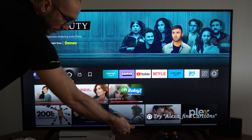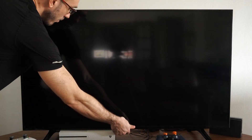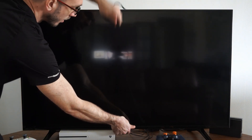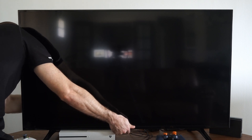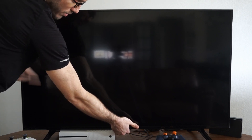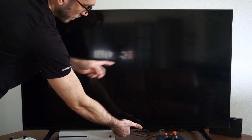So I'm just going to hold down the button right now and then unplug the TV. What I want to do is plug the TV back in — I got the power cord right here in my hand. I'm going to plug it back into the back of the TV, and keep holding down the power button on the TV under here, until you see the Fire TV logo pop up on the screen.